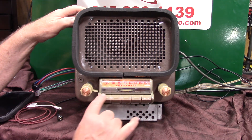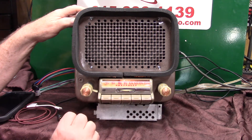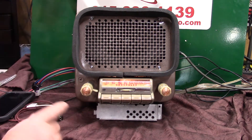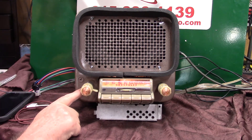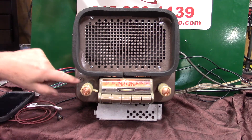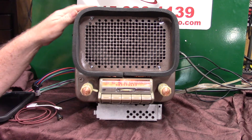We've re-polished everything on here and these are brand-new push buttons. I got the knobs with the radio. What we had to do was change out the potentiometer — that's your volume and on/off switch. The one that was in it was in pretty bad shape, so we changed that out. Now you have a full-time active toner instead of a toner switch.